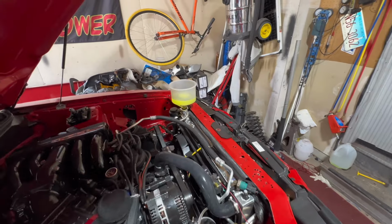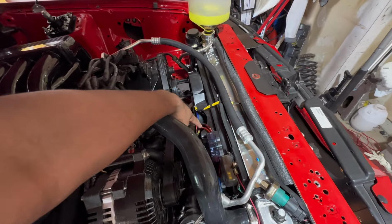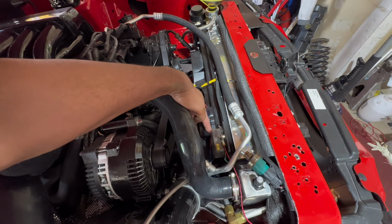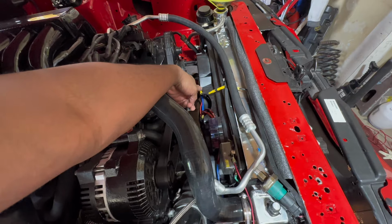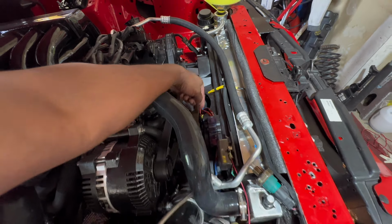All right, everything's wired back together. Just a brief recap. These two wires are going to each fan motor. This wire is coming from the CCRM. This is my ground wire to each motor. And that red wire is the pulse width modulation signal.